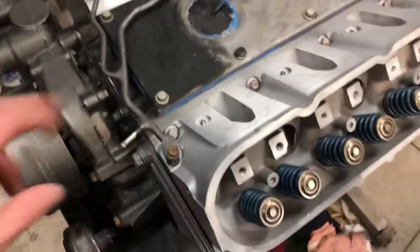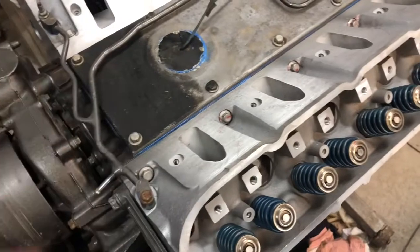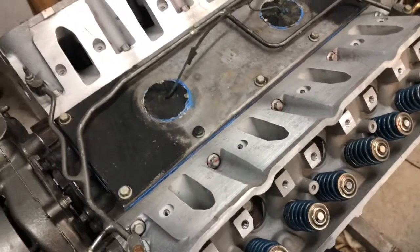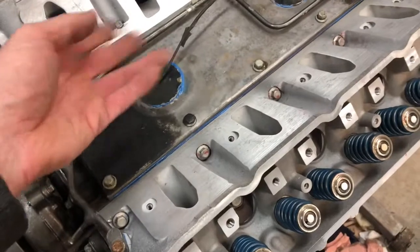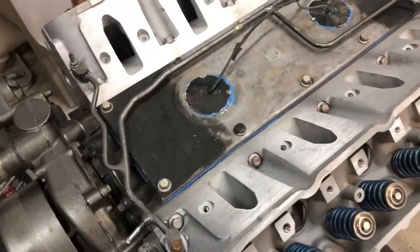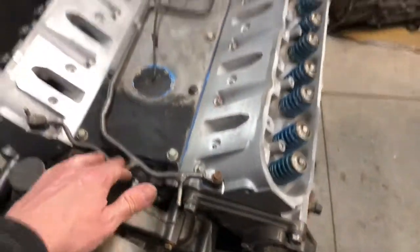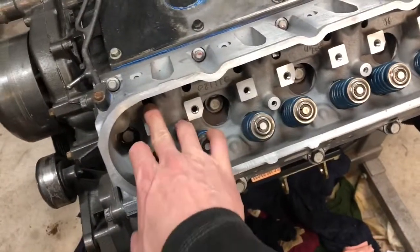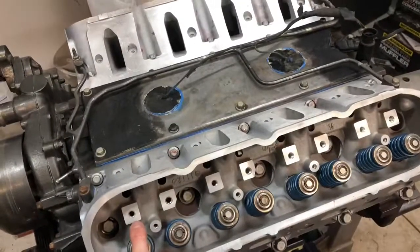Okay, so I got the heads on and torqued down, and I went ahead and threw the valley cover back on. I'm not going to go and buy every gasket for this motor — of course I'm going to invest in head gaskets, but come on, the valley pan — I just took the old gasket, gave her some gasket maker, a nice coating, and threw it back on. Knock sensor: same thing, it had silicone there before. They kind of pull out really easy, so I just gave it a little coat of silicone and dropped them back in. Got the crossover tubes back on. So that's about as far as I'm going to take it today — I'm waiting for my tool to measure the push rod length so I can order the appropriate push rods and finish this thing off.